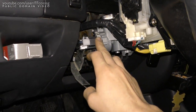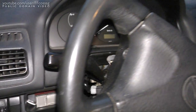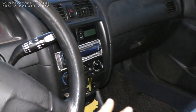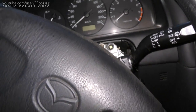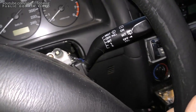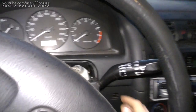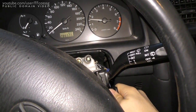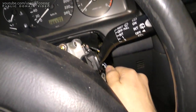Let's get to the car and see if it works. Moment of truth — here's the part I've fixed, reinstalled with just one screw and one snap lock. The symptom of this vehicle was that it would click a relay when you tried to engage the starter, but the starter would not engage. Sometimes after considerable messing around with the key it would make a horrible rattling noise and sometimes even launch the engine turning backwards. Here's to hoping — let's give it a go.